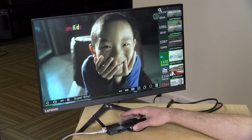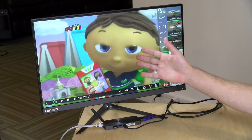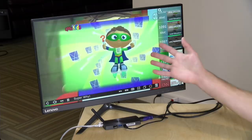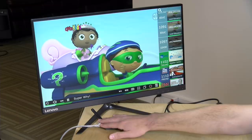Let's take a look at how this thing performs. I figured I would kick things off with some TV watching. We've got my HD Home Run working here — this is a device that allows you to tune your over-the-air broadcast or cable TV broadcast over your network. In full disclosure, they are an occasional sponsor here on the channel. We're running some broadcast coming over my cable system, and this is something that really bogs down a Wi-Fi network typically. A lot of times these mini PCs that don't have Ethernet are not able to play back this stuff smoothly because of the tremendous amount of packets that come over, especially for over-the-air broadcasts that work in MPEG-2. It's able to keep up very nicely here because it does have that Ethernet built in. The Wi-Fi here is 2.4 and 5 GHz, but I don't believe it supports wireless AC. So the Ethernet is really important, especially if you are tuning over-the-air broadcast. You can also see how quickly we're able to switch between channels here.